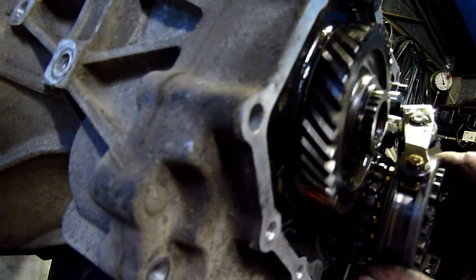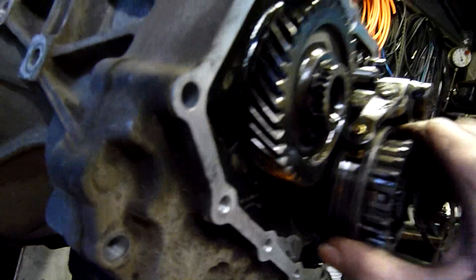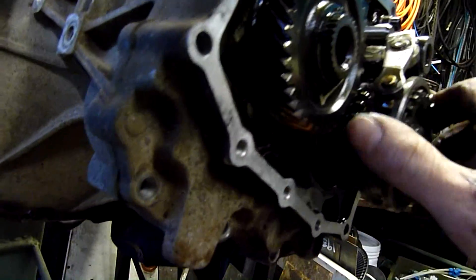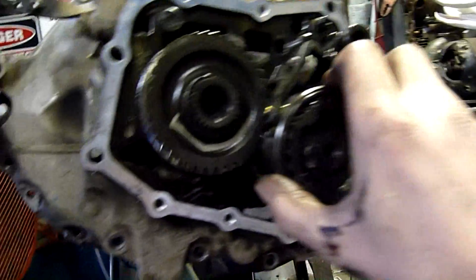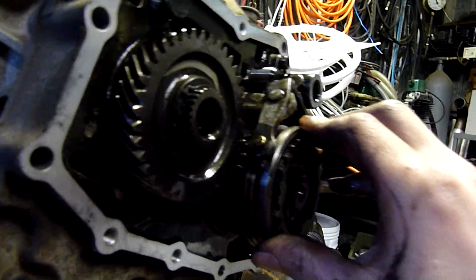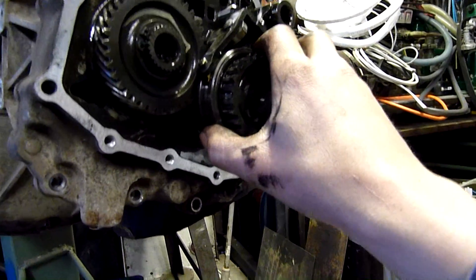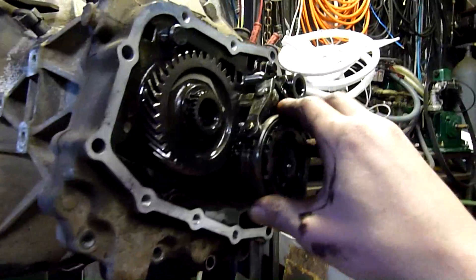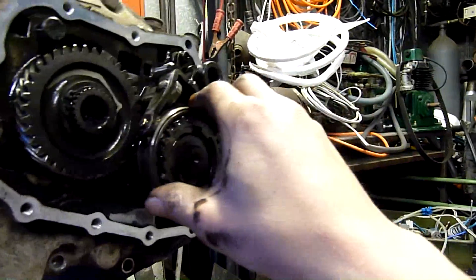You can see there - yeah, that'd be the reverse. Right now if that one's running anti-clockwise, they're both running anti-clockwise, just at a different rate. It might be fifth gear. I know on the RAV4s, this end here - you can get to it through the passenger wheel well - and repair the fifth gear engagement issue by replacing these little synchros. That bronze or brass disc in there is a synchroniser, which means you don't have to double clutch when changing gears on a modern manual transmission.